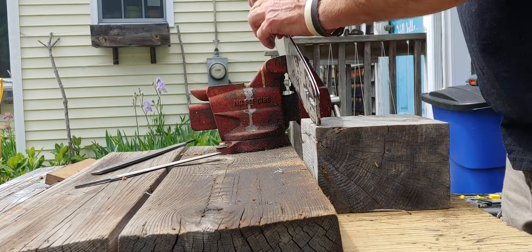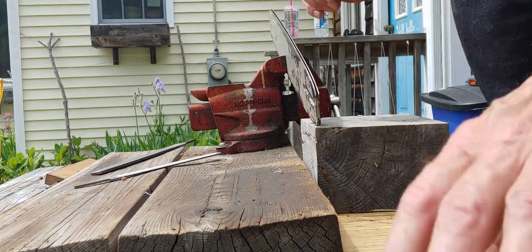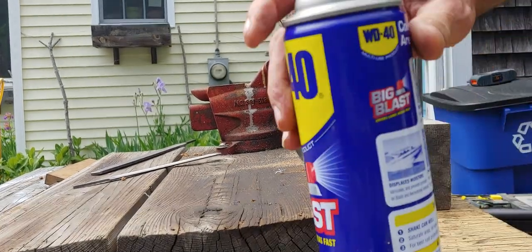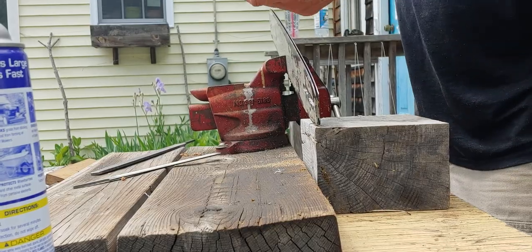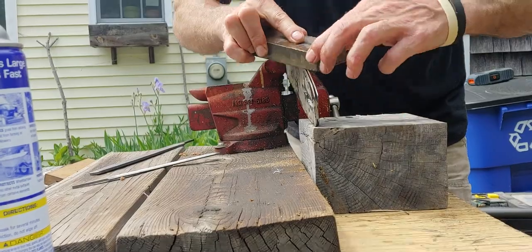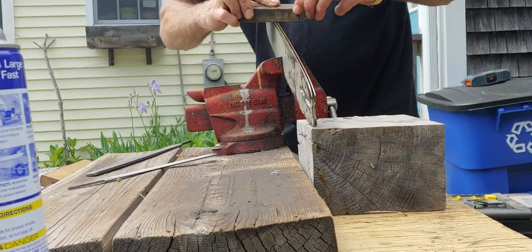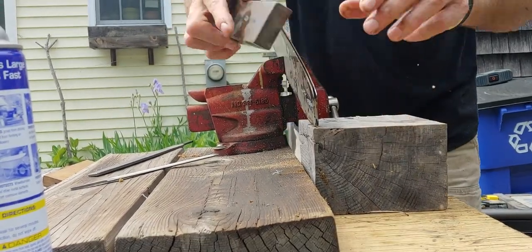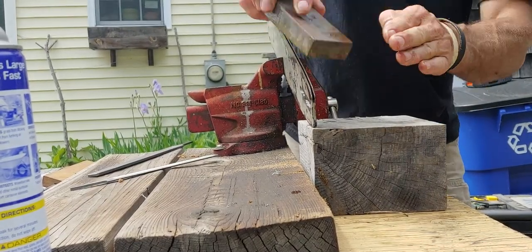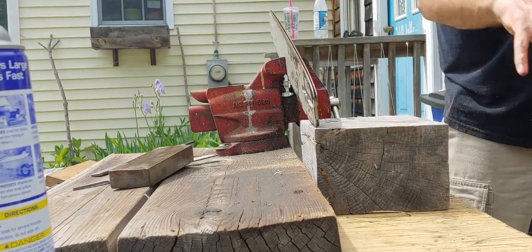When you clean off the burr on the side, the burr will come kind of back around to the top. So I like to stone my bars — it's a completely unnecessary step for the most part — but just any regular bench stone, it just kind of smooths them out a little bit, gets rid of the burr. And this isn't really removing any metal so you don't have to worry about going too far.